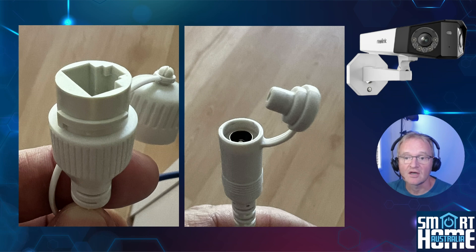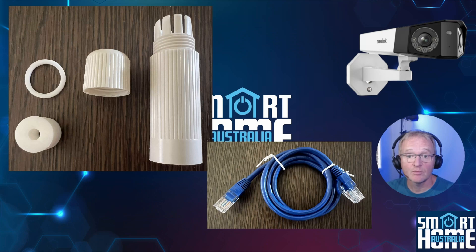There are two cables from the back of the camera. One is for the LAN and PoE connection and the second is for an optional 12 volt power supply available from Reolink. Both come with protective caps. Note there is no built-in Wi-Fi for this camera — that is serviced by the Duo 2 Wi-Fi camera. To protect the PoE LAN connection there is a protective cover that makes the connection weatherproof. Reolink also provides a one meter LAN cable, though most users will use a cable specific to their requirements.